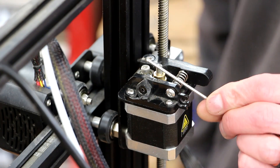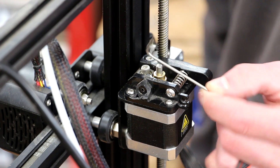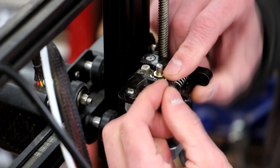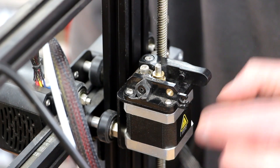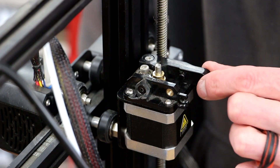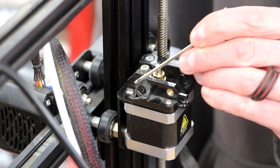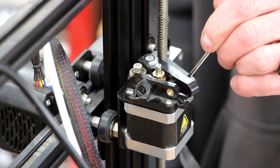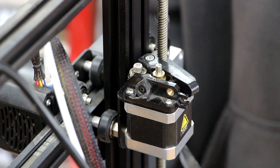To make this entire repair, I'm going to try to use just the Allen wrenches that were supplied with my printer. First, I'll remove this screw that holds the tension spring on the arm of the extruder. With the spring out of the way, this stepper motor actually bolts to this bracket. There are four screws that need to be removed before we can get this piece out of there — a screw here, a screw here, one on top of this arm, and then one that hides under the arm.